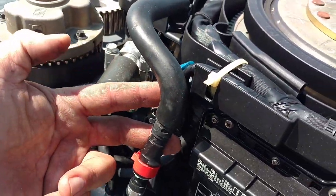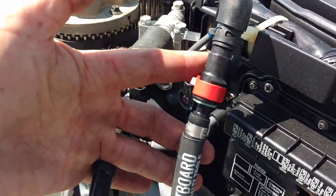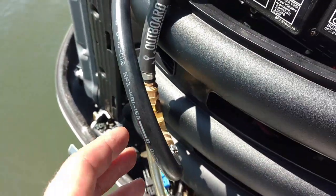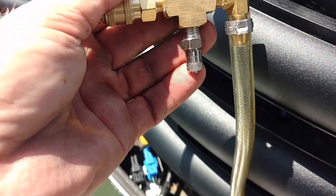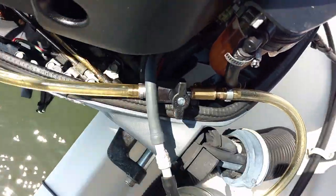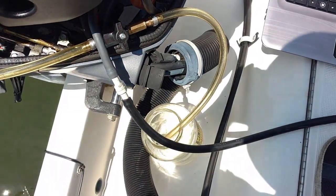I've gone ahead and disconnected the high pressure fuel line — this is the motor supply line going to the injector rail on the starboard bank. I've put our quick connect on their supply here, and our other quick connect is going into the quick connect barb on the top of the starboard fuel rail. This attachment allows us to hook up a fuel pressure gauge onto this fitting here, which is a Schrader fitting capped off to protect the threads. It also allows us to inspect fuel samples as we'll see in a minute. This clear line here goes to my shutoff valve.